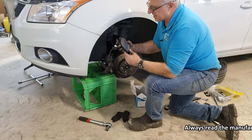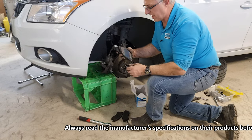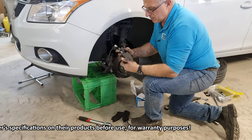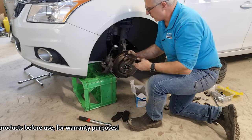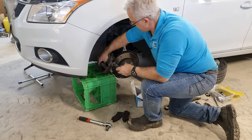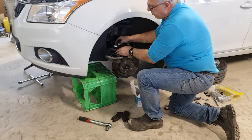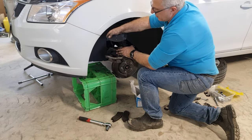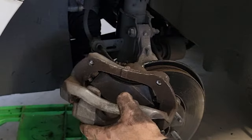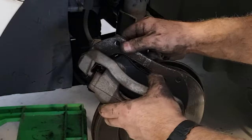Now it's time to put the brake pads in. You can see that Bendix has a mark here — the mark basically tells you that the brakes have not been worn yet, which is a good indicator. There are two different types here. The ones with the prongs on the outside go on the piston end for this Holden Cruze, and this one with prongs in the middle goes on the opposite end. The way you place them in — you can see the dome going downwards, so it's got to be the same direction. There's a little bracket here made of thin metal that has to be manipulated for you to get it in.